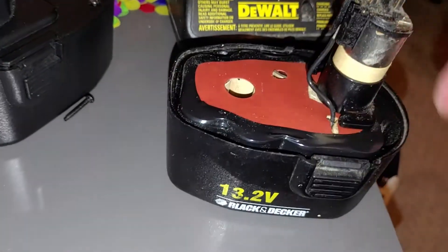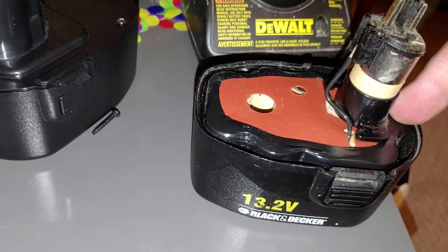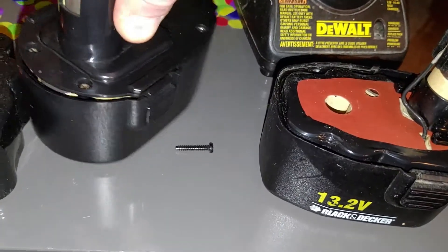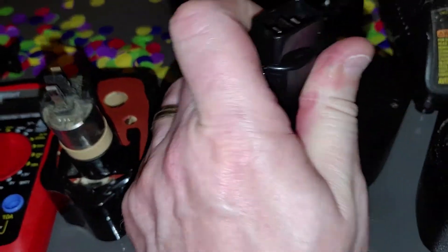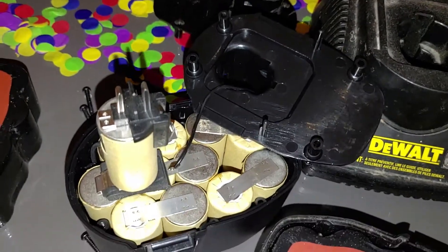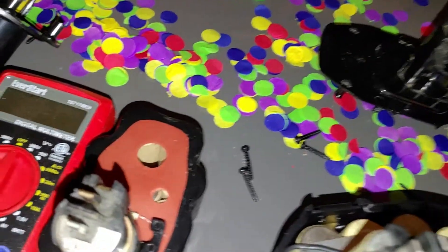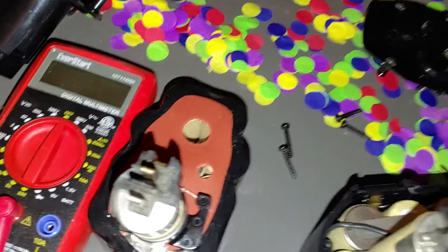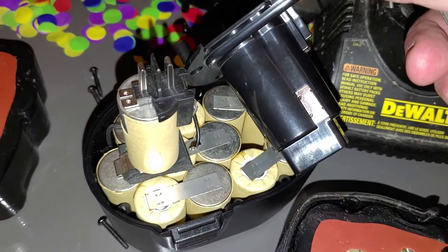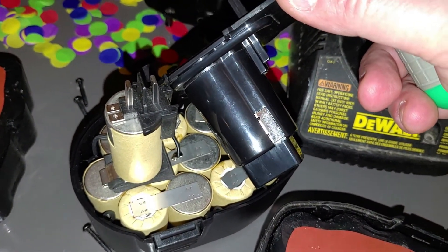The battery pack inside the original is clean — no cells exposed or exploded — it's just old and the batteries don't hold charge anymore. Now the new 14.4-volt battery pack is exposed. There's a little surprise in here: an extra negative wire that goes into a contact on the side of the PS1420, and I'm assuming that's used for the auxiliary light that comes with the 1420s but not the 1320s.